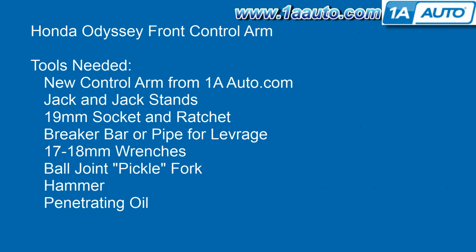You'll need a new control arm or control arms from 1AAuto.com, jack and jack stands, a 19mm socket and ratchet. You'll need a breaker bar or a pipe for some extra leverage, 17 and 18mm wrenches, a ball joint separator, sometimes called a pickle fork, a hammer, and some penetrating oil.